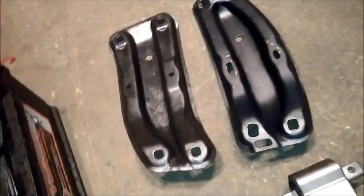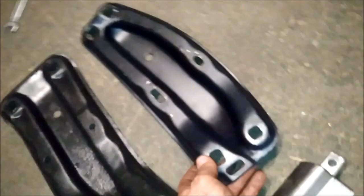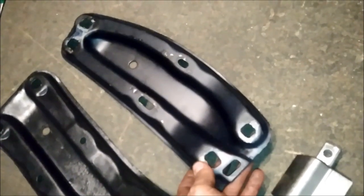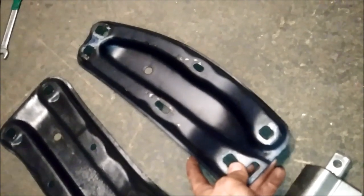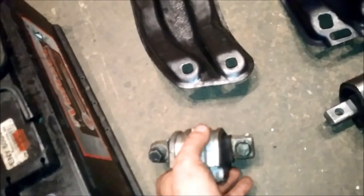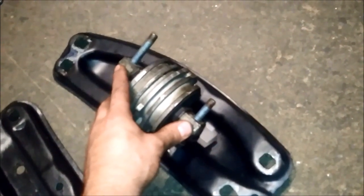I chose the manual mounting piece because I already used it in my diesel racer — it works well with the newer, later gearboxes and also with the original mounting point from the 202. It sits like this, but you need to modify it a little to fit the newer gearboxes because the whole distance here is different.